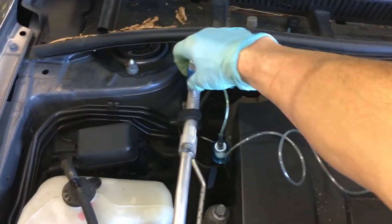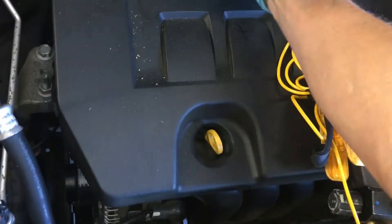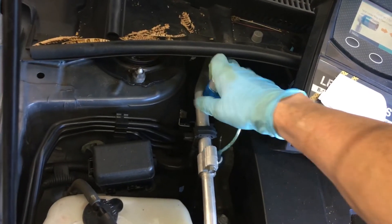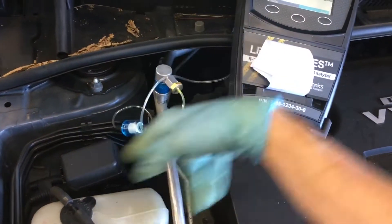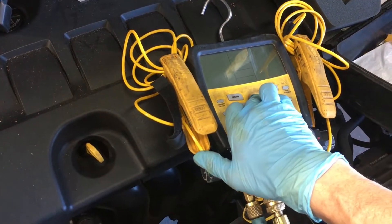It's connected but not screwed down yet — I still don't have refrigerant flow inside there. Now this has to calibrate, go through its warm-up, and I'll get everything else ready. This is not included in book time yet for performing your recovery; we haven't even gotten to the recovery part yet — we're just analyzing the refrigerant. Now it's ready to test, so I'll screw it into the refrigerant circuit. Now there's refrigerant flow going through the machine and it'll take a test.